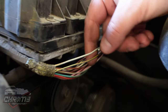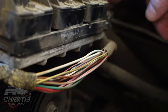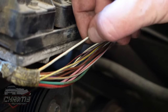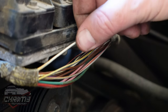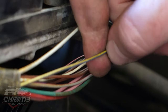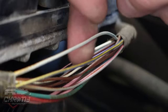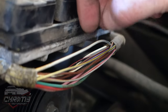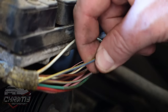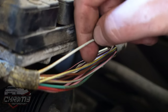Today we'll be showing you the wires you need. We've just cut it out here - it runs down your DFI module. We've got a light blue and white which is your 3x signal from the crank angle sensor, and then we have the blue and yellow which is 18x. These two will get wired to your BR on the green and yellow wire. The 18x goes to the green wire, and the white and blue which is your 3x goes to the yellow wire.